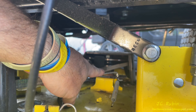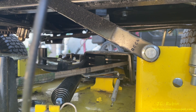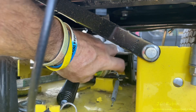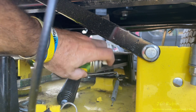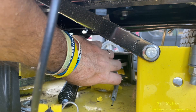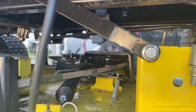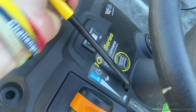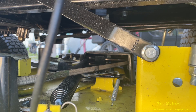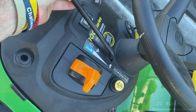There's a diagram in the manual for the work we're about to do. First is the deck idler pivot — I move the blade engagement a couple times so we can see how it functions. Then I hit this piece all around with spray lubricant, trying not to get it on the belt or pulleys, just on the area where metal comes in contact with metal. Then I run it a couple more times to work that lubricant in.